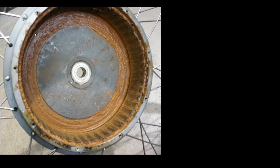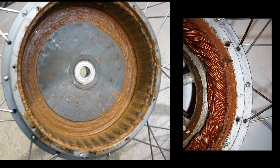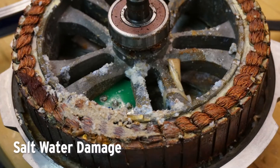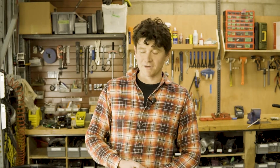People often have water inside their hubs for quite long periods of time without actually noticing it. For the most part it takes a long time for water inside a motor to actually cause damage that you as a rider can notice — there are cases where water might be sitting in there for months before any symptoms show up, like the motor being stuck when it freezes. Other signs that you could have water ingress include erratic behavior with the hall sensors, because water can saturate the electrical connections between the hall signals and cause those signals to lose integrity or get pulled to ground, so your motor controller can't respond appropriately.